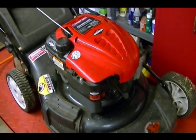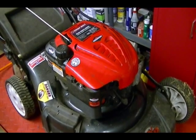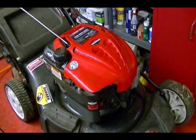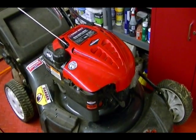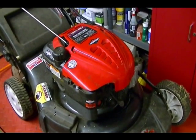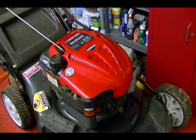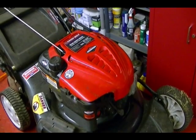In this video, I'm going to show you how to clean the cooling system on a Briggs & Stratton single-cylinder L-head lawnmower engine. These engines are air-cooled, which means that they have cooling fins on the cylinder and cylinder head, and they rely on air being able to flow past those cooling fins and through convection remove the heat from the engine. What causes the air to flow past the cylinder cooling fins are the fins on the flywheel and the passages created by the engine shroud.